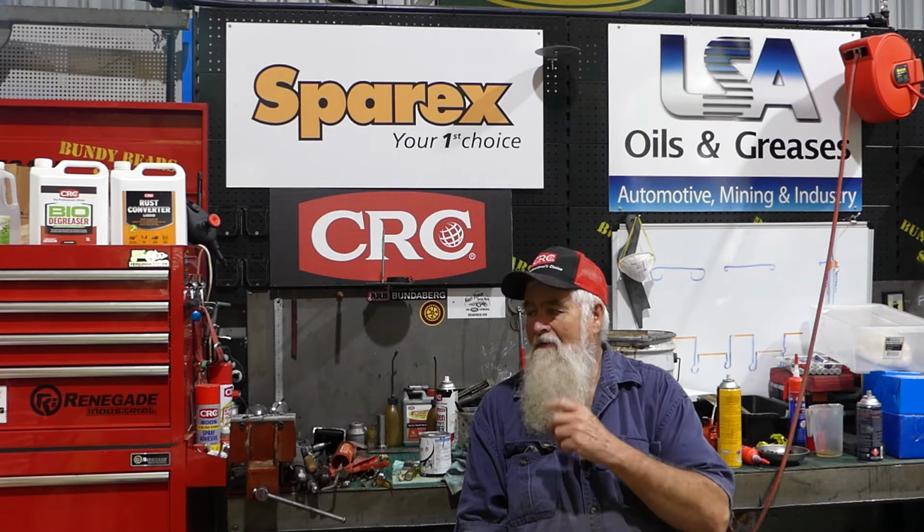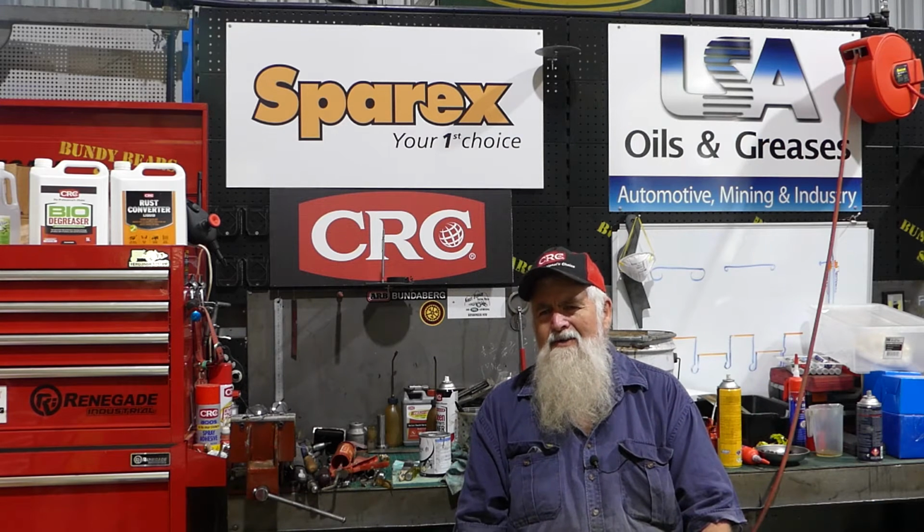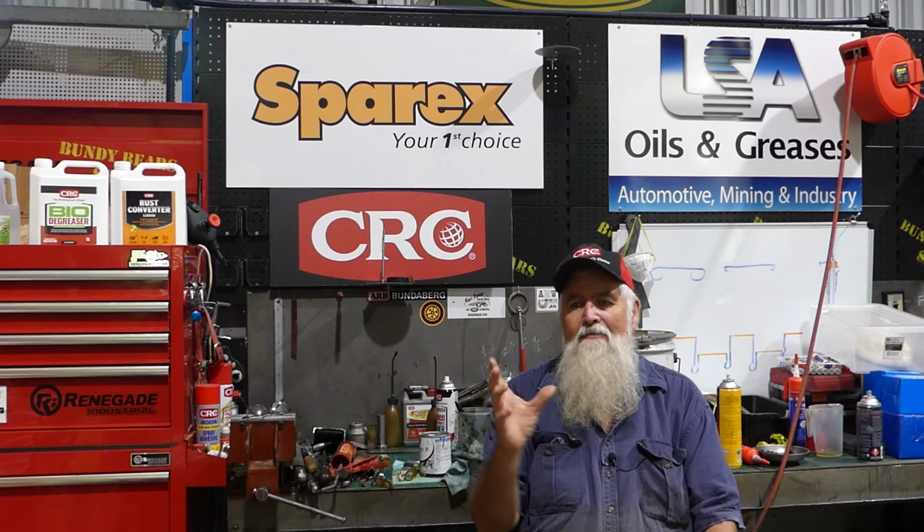So I pulled the blades off the day before I greased all the deck and all that, sharpened them up, and when I'm putting them back on, I'm thinking, oh, something's wrong here. The spindle near the chute for getting rid of the grass has got a buggered bearing in it, so I didn't have much to do, so I greased her up and finished it.